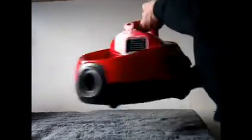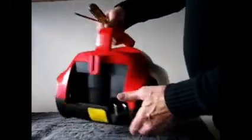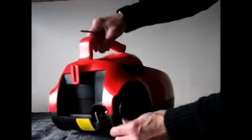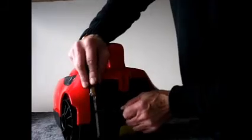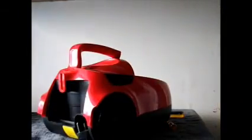Now at the moment, so far we've removed four screws from inside the dust compartment. We've removed our exhaust filter and the two wheels. Now so far you'll find the case still won't come off. Once again, we've got to do a little bit of easing off of the plastic parts. Now at the back of the machine here, pull out or spring up the back of the case there, and do the same on the other side. After we've removed these two tabs and got them out of the way, now you can pull up the top. And that's come off very easily, so don't be fooled by that.